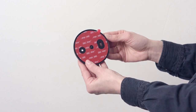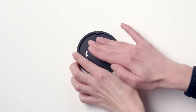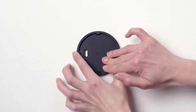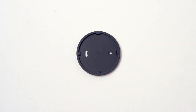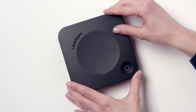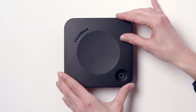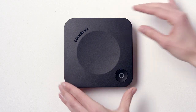The ClickShare CX20 has a mounting plate which you can use to fix the base unit to a wall. To do this, either peel off the back of the adhesive sticker on the mounting plate and push the plate onto the wall, or drill holes in the marked positions and screw the mounting plate onto the wall. Now move the base unit a quarter turn anti-clockwise and push it onto the mounting plate, then move the base unit a quarter turn clockwise, and the base unit should be held securely in position.